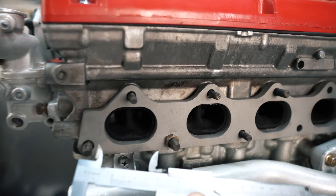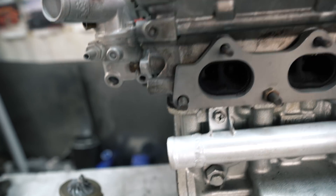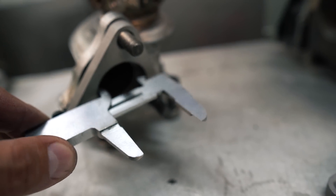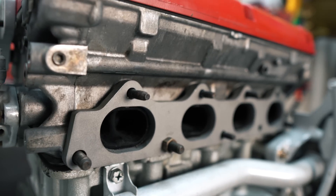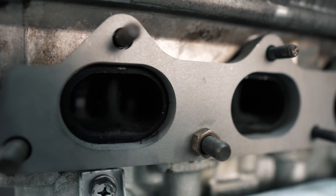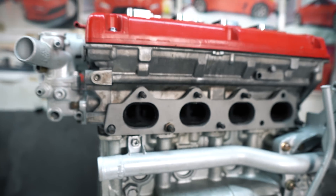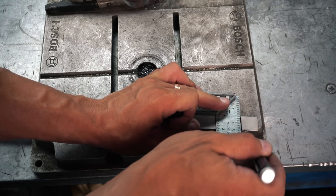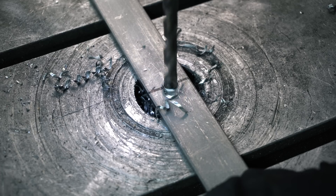The exhaust windows on the GBC have an oval shape, and their size is about 57 mm by 40 mm. The inner diameter of the inlet on the hot part of the VR4 turbine is about 40 mm. The runners from the hot part of the GBC to the turbine I will start from a 50-51 mm tube. This tube should be optimized to cover the area of the exit window, although the turbine inlet area is a little more than the GBC window area. Usually they do porting of these windows first, so I will show you one.